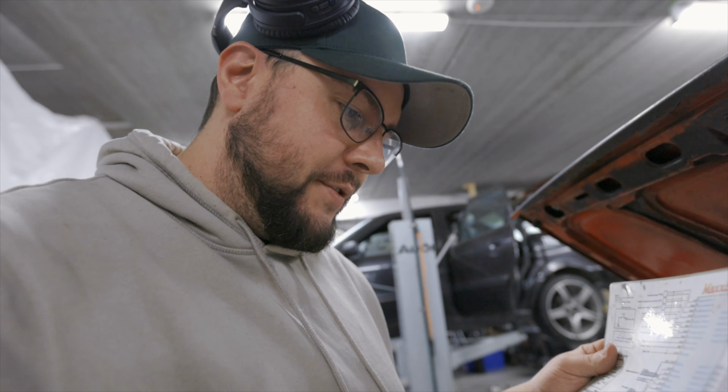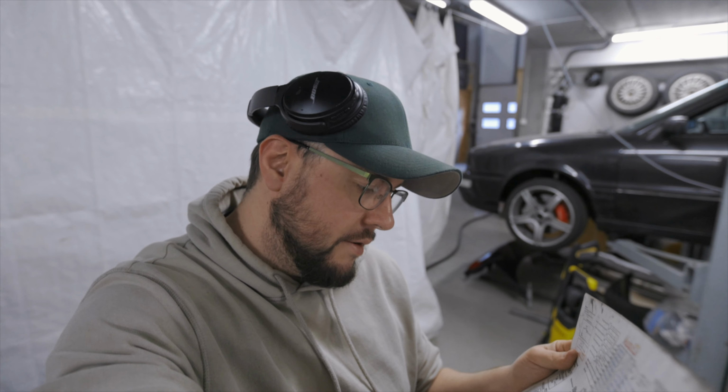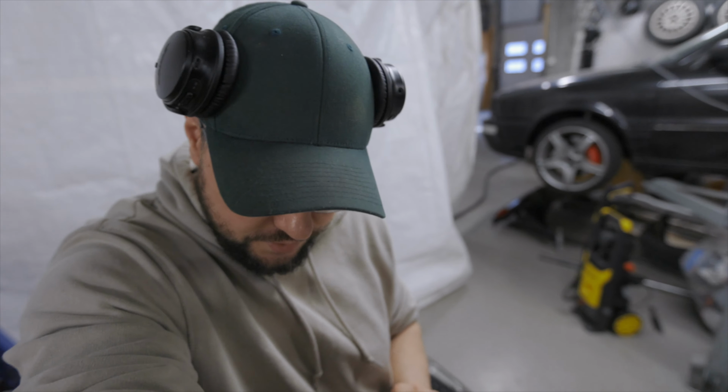Just realized something. I found an output from the ECU wire when I want to use it as an input, and apparently maybe I was talking a bit too much about how great the Max ECU is, because outputs you can use for different stuff, a bunch, all of them, but that's output. But for input, there are specific ones, and you can't use an output as an input, and vice versa. I need to find the input, and on this Max ECU Street I have 2 of them. I have not used any of them, so I will take one.